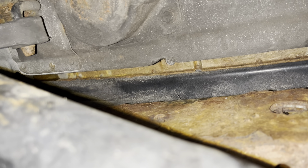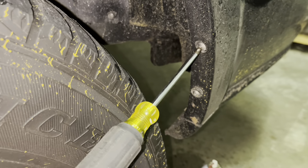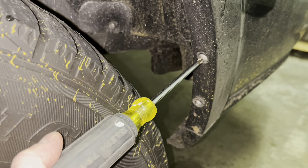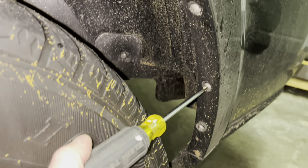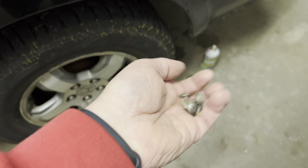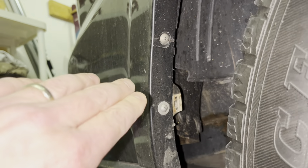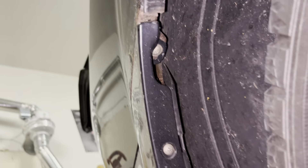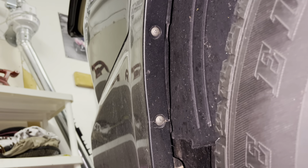I'll try and get a good shot of those. I'm removing all these screws by hand with a Phillips screwdriver, just because this is all plastic, and these are actually coming out pretty easy. Just remember, there are going to be four on each side. The lowest one as well as the one tucked up inside — those are the two that are going to have the washer. The two in the middle will not have the washer.